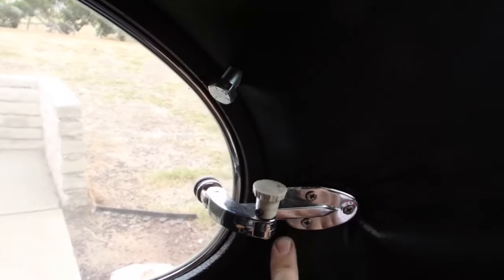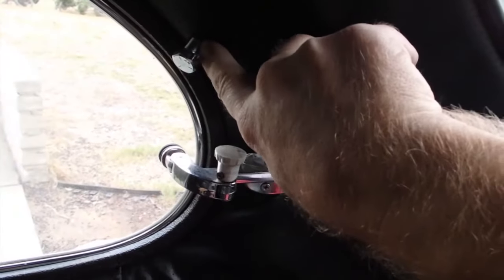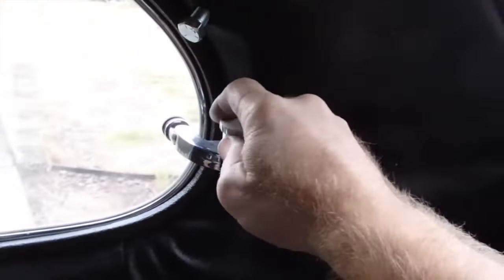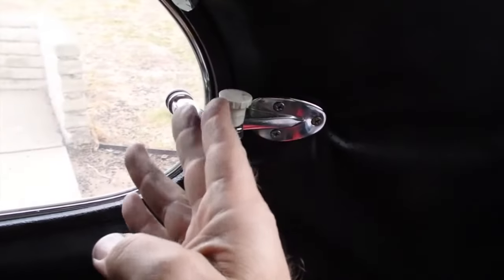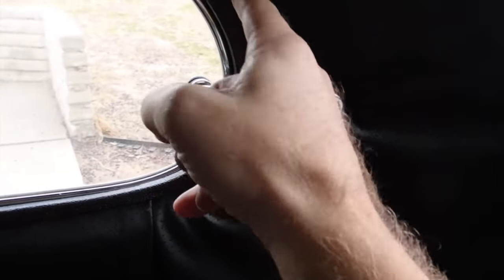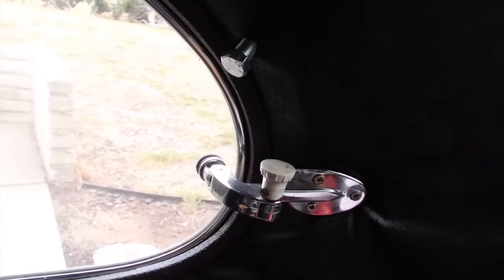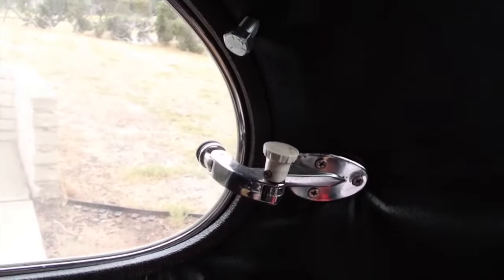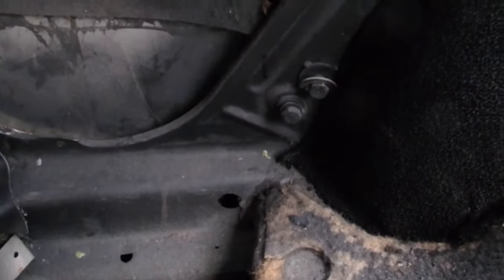For those of you searching like I did for the upper mount — you can feel it right up there, about three inches above where the pop-out is. Or, for those of you that don't have pop-outs, just a little bit past where the curve is. That's where I'm going to mount the top part of the seatbelt.